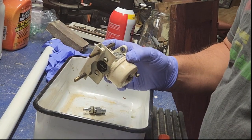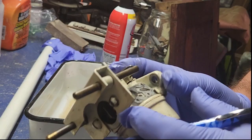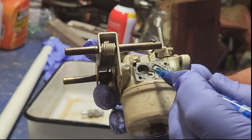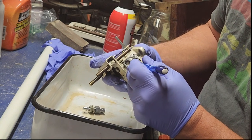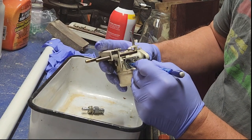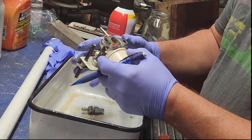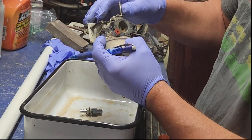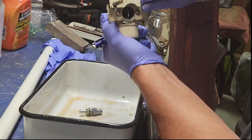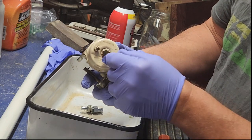It's got a little rubber rub-off on the back side — that's the gasket that came off this way. It's got a little guide so we know how it goes on, with a little point on one end. It gives us the push-down that we want. Right here I think is a screen — it's got some gunk in it, the screen's done its job. Before we go any further, you can see the valve works and this is the choke — see the choke closing there? It chokes the engine, so that's working.